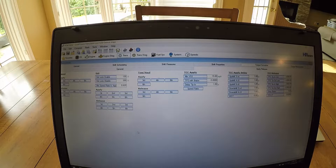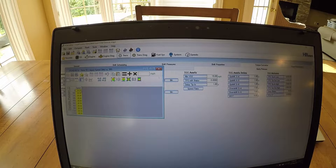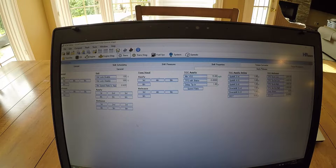And then the torque converter — I've enabled the hot tunes. I went in here and changed it so that at 120 degrees Fahrenheit the hot tunes can be activated. I've locked the torque converter in second, third, fifth, and sixth. Fourth is only used when the transmission is really cold, so it doesn't really pertain to this application. This particular setting in fifth — I've told it to lock up at 26 miles per hour. It basically works really well. I've got it locking from second all the way to sixth now.